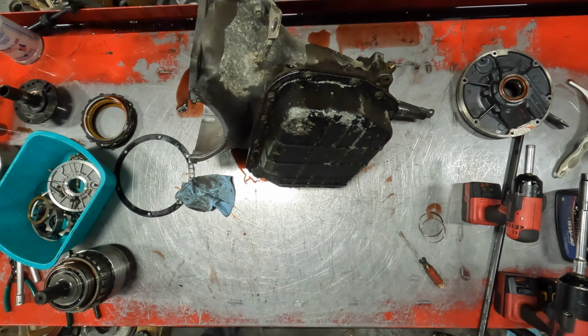It's got one of your blue cut rings, but also a solid O-ring. That's why they're tough to come out. The blue cut seal doesn't do anything until it gets pressure to expand. The O-ring seals all the time. Now for the second gear servo.